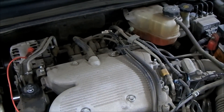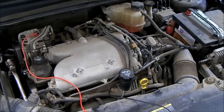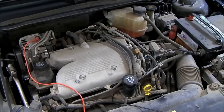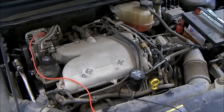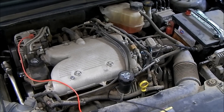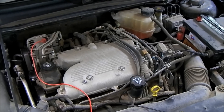That's voltage drop testing a charging system circuit. It is very simple and honestly very seldom done out in the real world. From experience, there have been plenty of times where I've seen a charging system problem, did a voltage drop test, and it was just a loose connection and not an alternator. We want to do the things to fix a customer's car that the car actually needs. Doing this quick test will help you make sure you're always on the right track in your diagnosis and repair of charging systems.